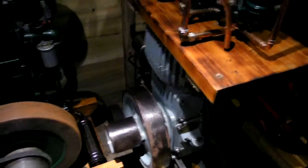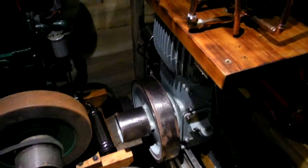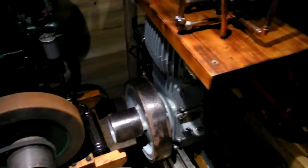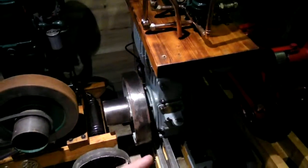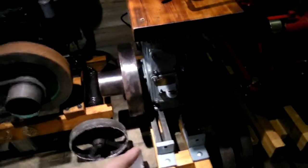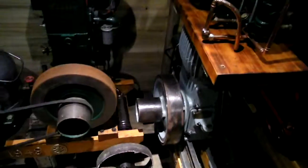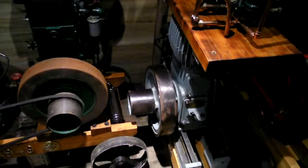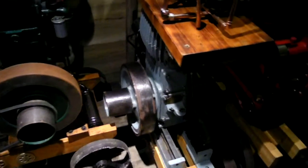The Wolseley hasn't been to any shows this year - I've still got a little oil leak. It's coming from this engine but I've checked and normally they leak around the seals behind the flywheels or where the crank comes out at the back, but there's no sign of oil coming from those at all, not even when it's warm. It's losing oil and always leaving a patch on the workshop floor. I've checked the oil plug and even had a look underneath for any hairline cracks. It's not coming from the inspection plate, not from where the valves are - it's all around the mag and I can't find where it's coming from. In the winter when I've done my extension, I'll hopefully strip it all down again and have a look.